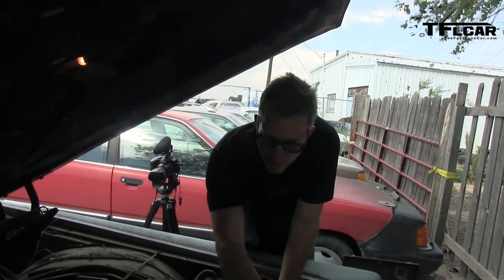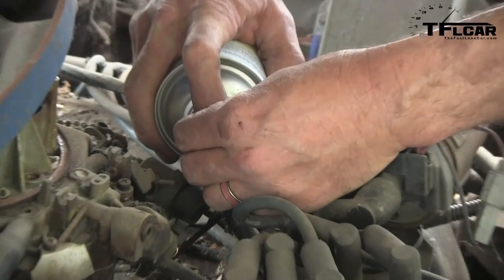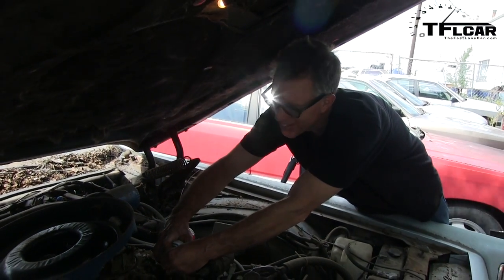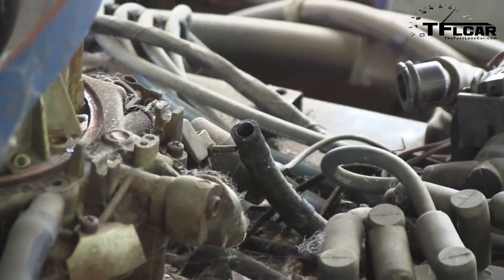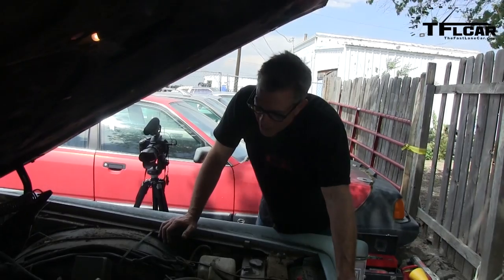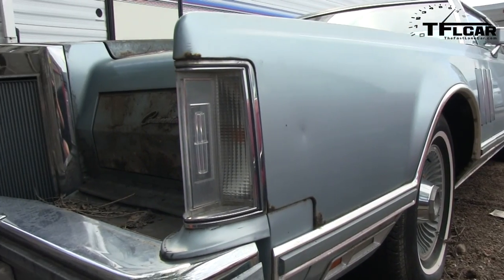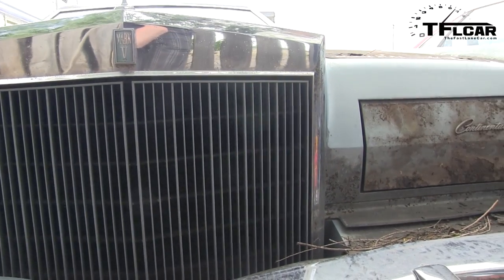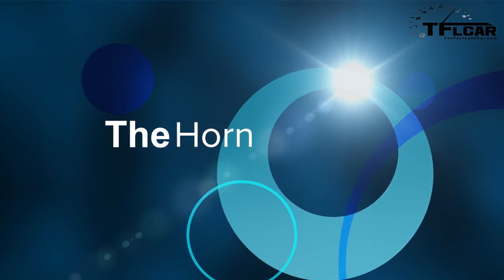The clog is off chance here, but usually this is one of those things where you take it to the shop, put it up on a lift, find all the metal fuel pipes, remove them, and either replace them or run carb cleaner down them with a long wire or an old speedometer cable like a roto-rooter and get them de-gooed that way. But sometimes you get lucky — we'll see.